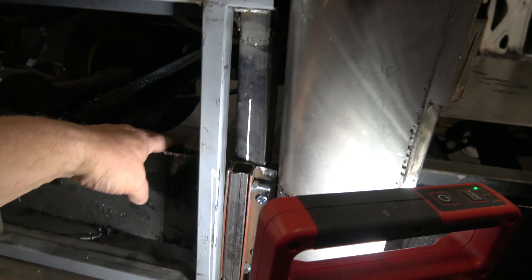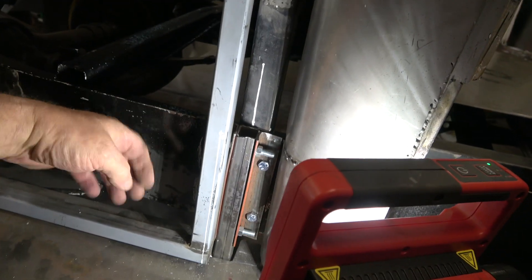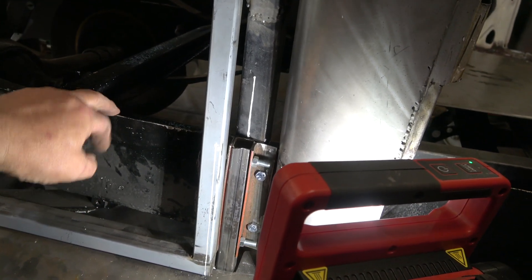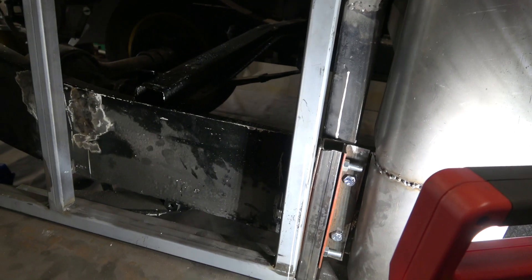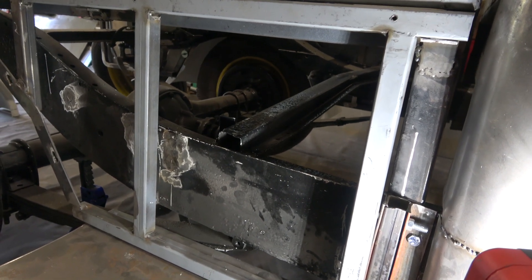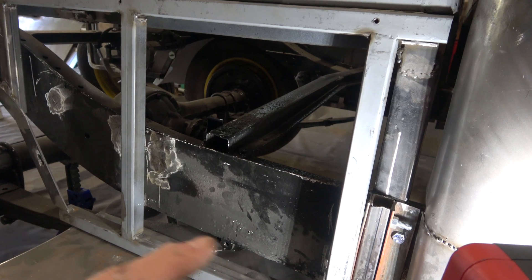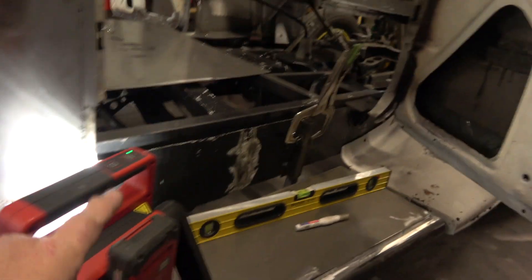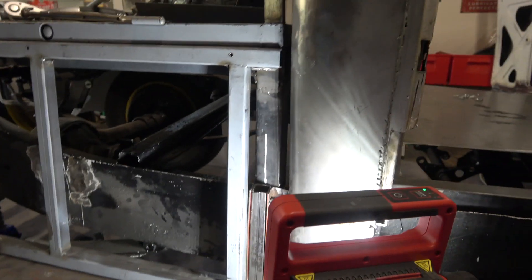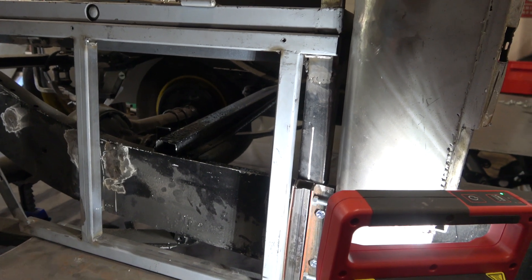What they would make is like a half box section — like a channel — and then they'd weld this on the outside of it. But of course this is the one that's taken all the wear over the 80-odd years it's been around, and it's got thinner — the wall on here — but the back is okay. There's so much debris inside it, it's unbelievable. I would say, if I do get rid of this or sell it to somebody doing up a Rosalie — a Citroën, a U11 — the thing I would do if I was restoring it is I'd take the whole side off all the way along and put a new one on. Then you could get in, clean the chassis out, sandblast it properly, and put a proper new 3mm plate all the way on. A lot of work, but it would be worth it because otherwise there's all the rust on it.